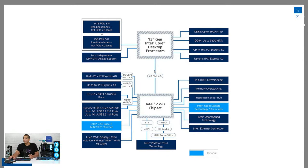The biggest item that I would say is a quote-unquote improvement is that you'll see a change in what are called the downstream links, or PCI links, where there's essentially an uplift in the number of PCI Express Gen 4 downstream links. On a motherboard, what that ultimately translates to is a little more flexibility to give more Gen 4 links for different types of devices. That would generally be M.2 based SSDs. That's generally where you would see the advantage.